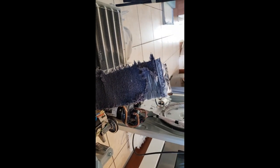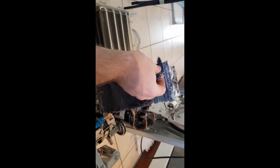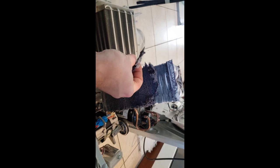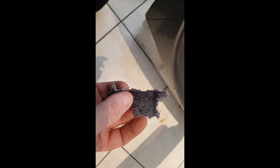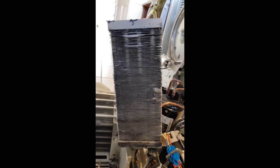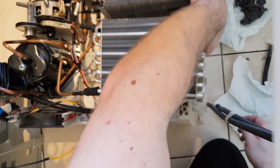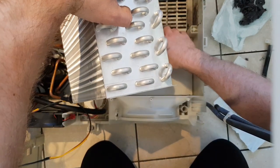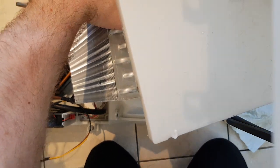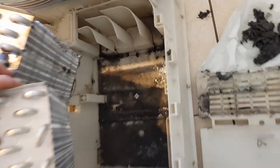Be really careful when pulling this up because you can bend the pipes. Look at that fluff - the problem with this one was fluff was in the evaporator. All you've got to do is pull all that fluffy stuff off and clean it. To give it a full service you'd want to take both coils up like that really carefully, pull that cover off.